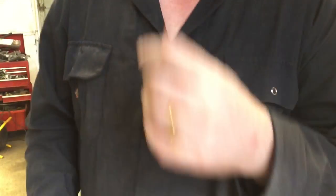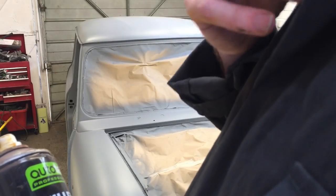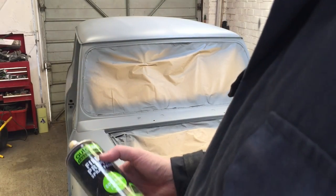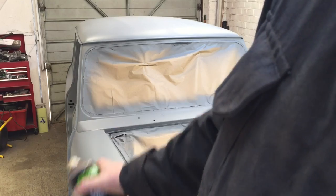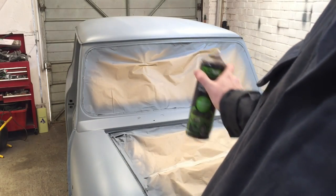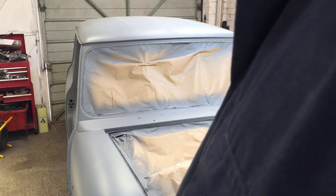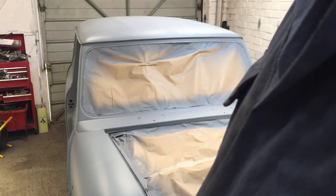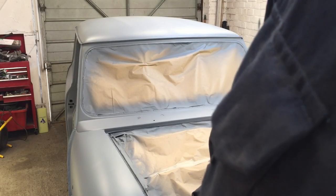It's been a while now since it's dried off. I'm just going to put what they call a guide coat on - it sounds like I know what I'm doing, but it's basically just a different colour you put on and then try and sand all that off, to guide you to see if there's any highs or lows. I thought I had some satin black but I've lost all the nozzles for the tin, so I've just got some completely different coloured filler primer - the other colour - which will be quite easy to sand off. I'll do random areas of the car, mostly the main things like the wings, the quarters, parts of the roof where I really want to do my best. I'll miss out the scuttle, bumpers, doorsteps.